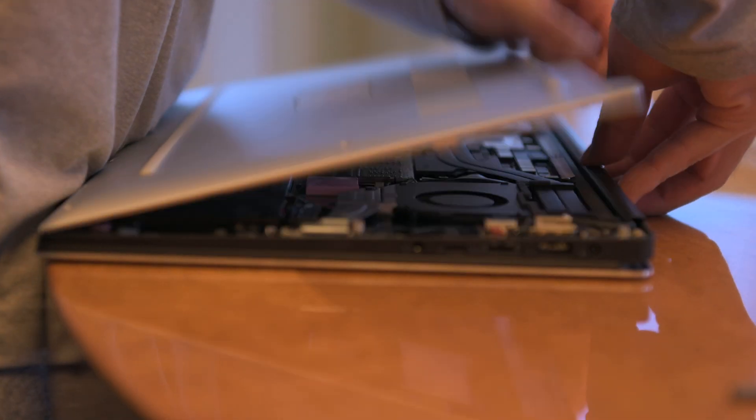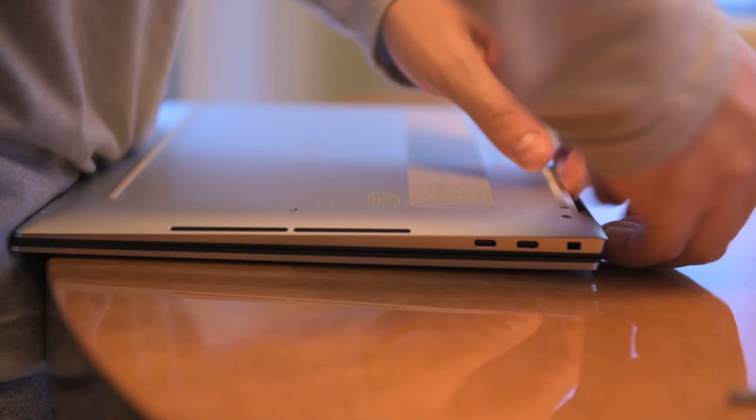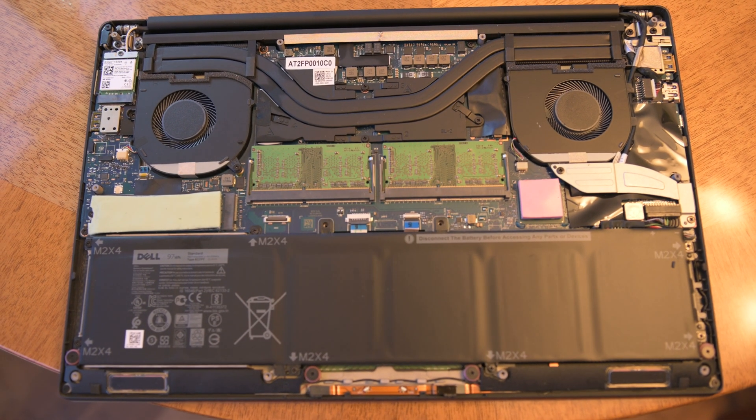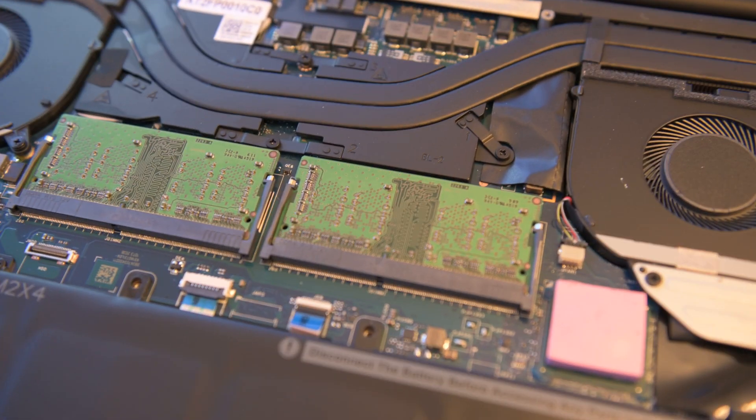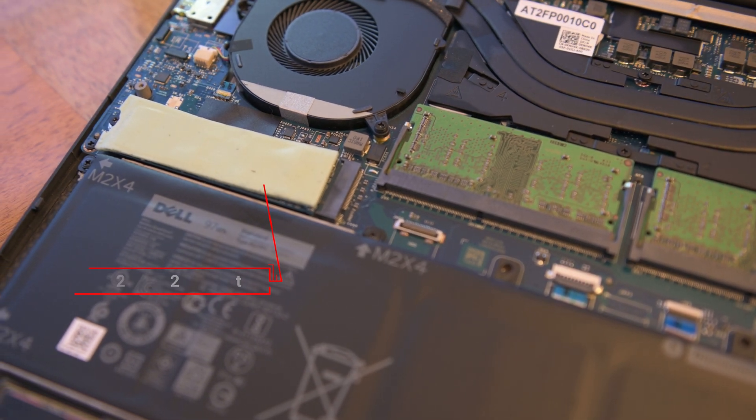To open these laptops up, for the old XPS you just unscrew the Torx screws in the back and pop off the lid, but for the life of me I couldn't open the back panel of the new Dell XPS. I ordered a pry tool kit — the back panel of the new Dell XPS is really difficult to get off. In terms of RAM, both laptops have two dual-channel RAM slots, but the new Dell XPS is at a slightly higher frequency of 2933 MHz versus 2666 MHz on the old one. Both have M.2 storage slots, but the new Dell XPS has two M.2 slots, meaning you can upgrade storage without reinstalling the OS by just snapping in a new M.2 card.